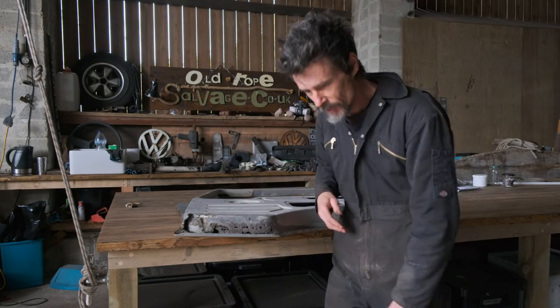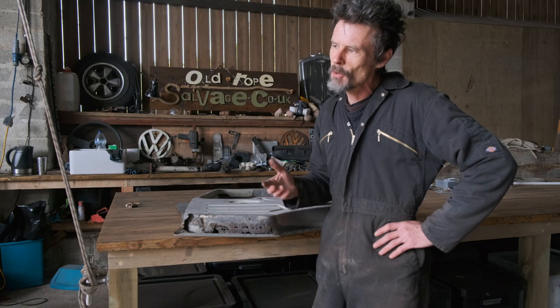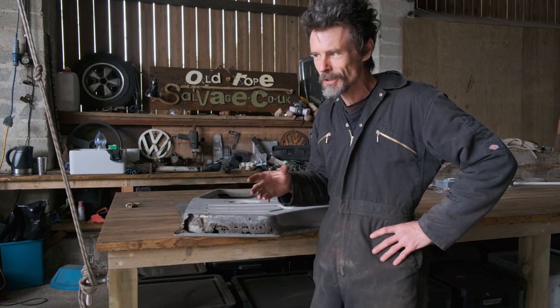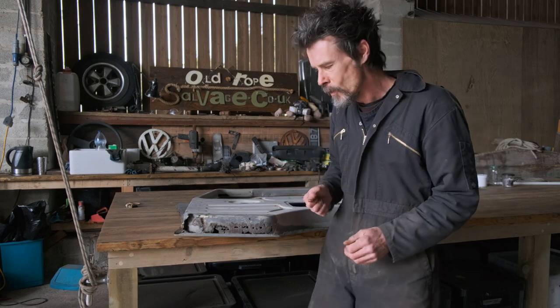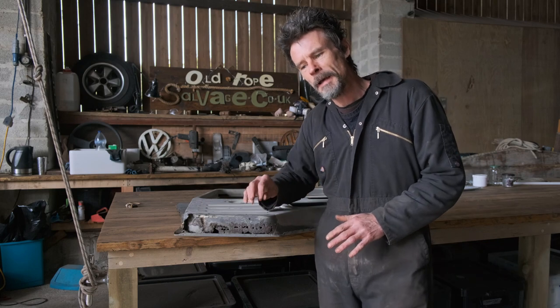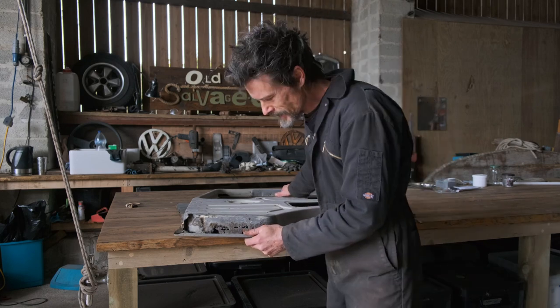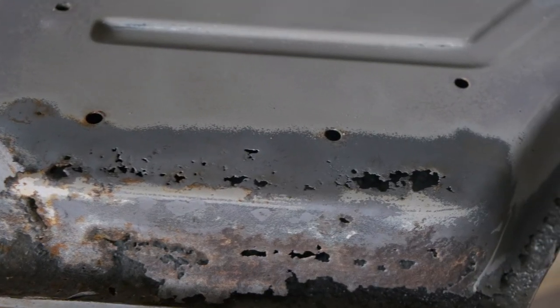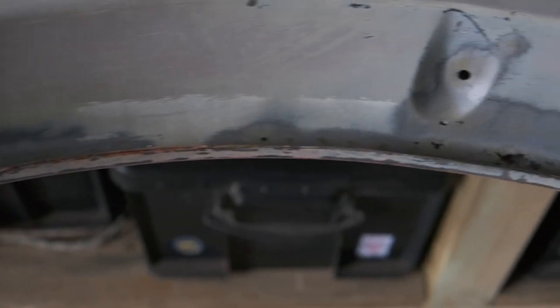After getting myself a little bit cleaned up, I'm a bit undecided about that really. The sandblaster — well, vapor blasting — it's a bit slow, but saying that it does really get it clean. So I might have to try maybe a few combinations: getting the wire wheels out and removing the worst of it, and allowing this to sort of get in the last bit. It turns the bottom of this into like a Swiss cheese — there are multiple little tiny holes, but you're right down to the cleanest metal. You can properly see what you're dealing with.